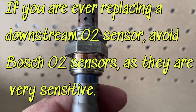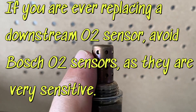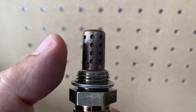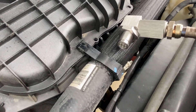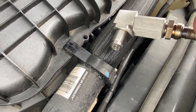Unless you have a lot of carbon buildup on your oxygen sensor, I normally don't recommend cleaning these, as the probe is actually on the inside. If you do want to try to clean it, the best cleaner out there is oven cleaner — just spray some on and wipe it off. Always be sure to wear gloves.